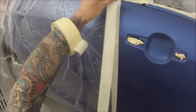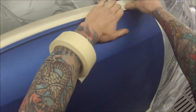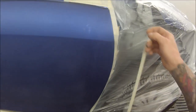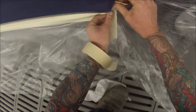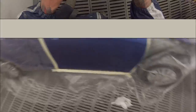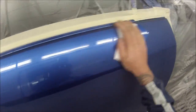I'm careful when taping around these edges not to cut through too hard because you don't want to cut into the surrounding panel. We're taping down making sure there are no little gaps. Notice I'm doing it mainly in big pieces of tape — if you've got five pieces running down a top or bottom edge, there are more gaps and more chance that overspray will come through. That's the main reason I use nice, long pieces of tape. Just tuck all that plastic under there so it doesn't flap back into your paintwork.